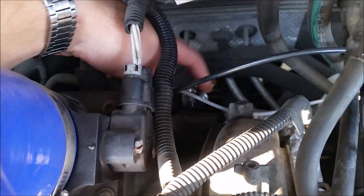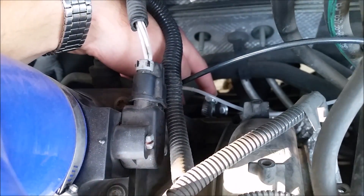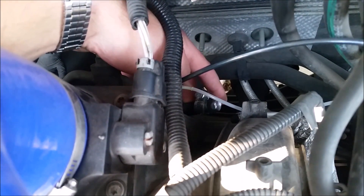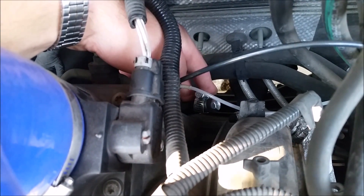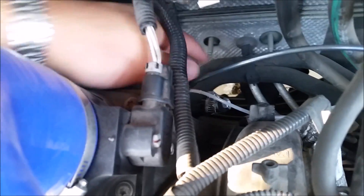For the intake, there was this little hose right here. This was connected to either the PCV or the airbox or something like that. Anyways, this goes into the intake manifold. So this is a little ghetto, a little janky, but I got a bolt that was pretty snug, stuck it in there, and got a hose clamp around it to hopefully eliminate any vacuum leaks or air leaks.